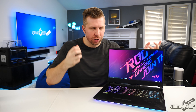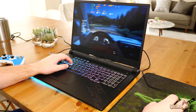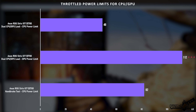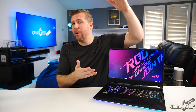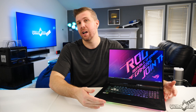Let's talk performance. How well does this thing actually perform for $1,700? Let's start with the power limits of the CPU and GPU, because that determines the performance potential of the internal components. In a dual load stress test, the power limit for the CPU is approximately 50 watts and the GPU has 112 watts. That's pretty good for the GPU, but a little bit disappointing for the CPU. At the same time, this is only a six-core CPU so we don't need quite as high a power limit to hit max performance. We do have shared heat sinks between the GPU and CPU, and you really have to power limit the CPU, otherwise CPU temps go through the roof because there's just not enough thermal headroom.